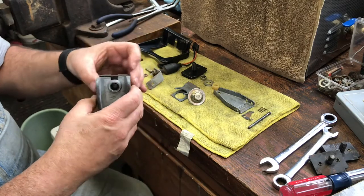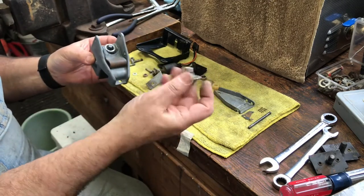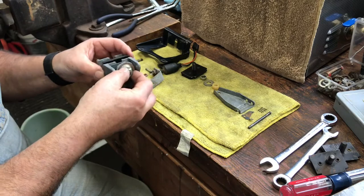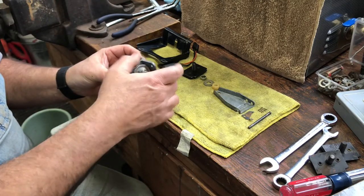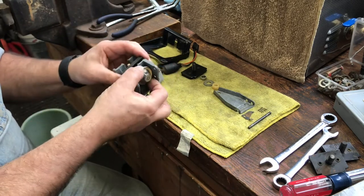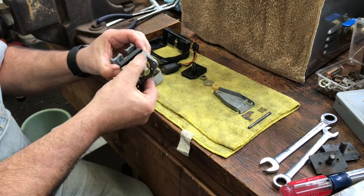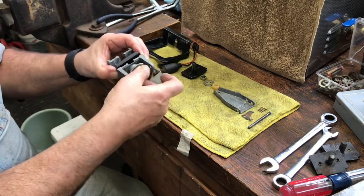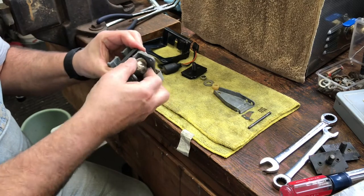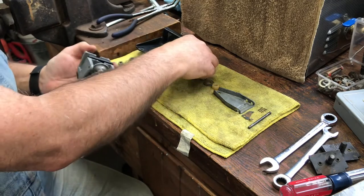Step two: put in one of the pads. Then the big spring. This is the self-adjusting nut - it'll go click, click, click every time you tighten the brakes. It'll tighten up a little bit, so it is a self-adjusting brake. That's just going to screw on there, and as you use it it's going to click outwards, which in turn pushes the pad inwards as the pad starts to wear. For now, let's crank it up fairly tight because we have to put the actuator up top.